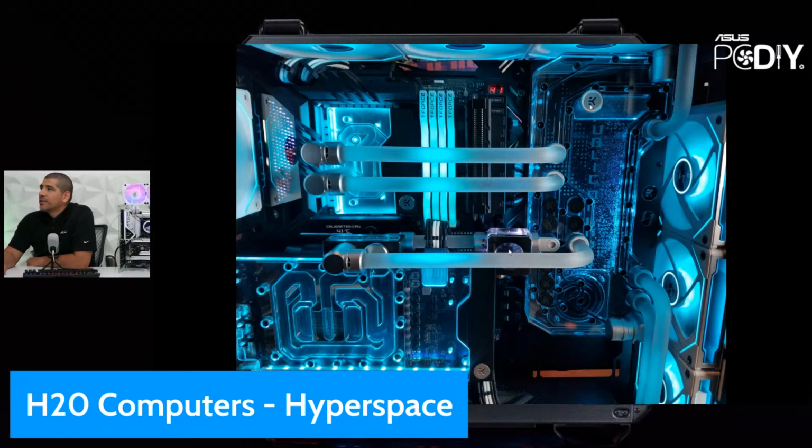One of the really cool things you'll see right here is the distro that you have integrated, the pump in the distro plate. This is in a spot that normally you wouldn't put this. The Hyperion is a dual 420 millimeter chassis, so you can put in 420 millimeter at the top and also in the front. This area right here normally has this ARGB light panel back there, and if you're not using the light panel, you would remove it. You could put it on your desk, connect it via a USB port, and put fans there.